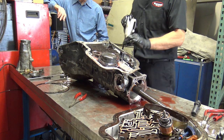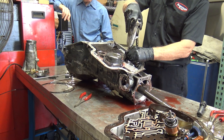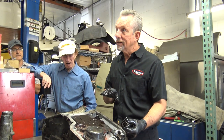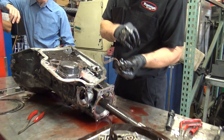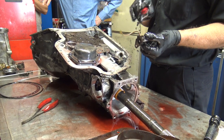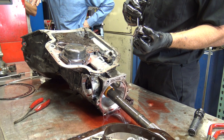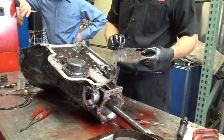What holds this plate in, aside from this, are witness points. But just because there are witness points does not erase the possibility of human error. You'll see there's a solenoid right here — it has this hole, and under normal conditions the spring holds it closed. But as soon as you put voltage to it, it opens that little valve and kicks it out of high gear.